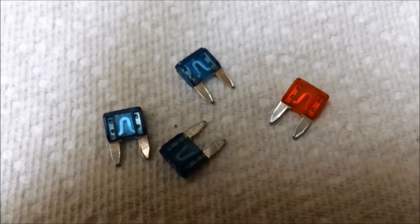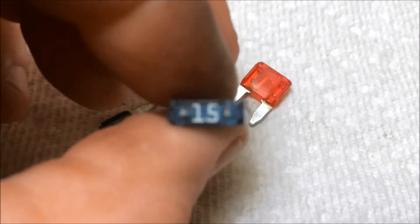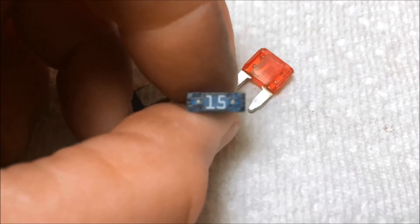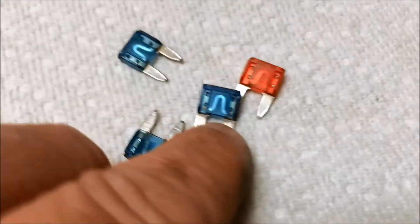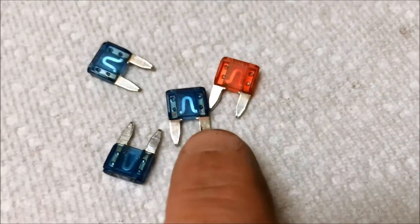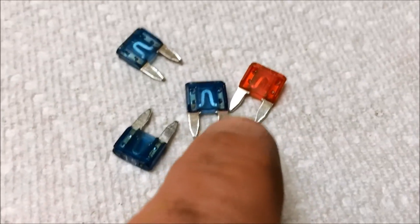I went to my mechanic and told him what I discovered. He shook his head and told me about a time with a Ford F-150 where he found a fuse where, if you look at the top just to the left and right of the number 15, you see the two little metal legs. He put an ohmmeter on top of those, and when he pushed down he was getting a reading — so he thought the fuse was okay. But when he actually pulled the fuse out, one of those legs broke off. What he discovered was that pushing down on the top was squeezing it together and making contact, but the leg was actually broken inside and not making proper contact. When he changed the fuse, it was fine.